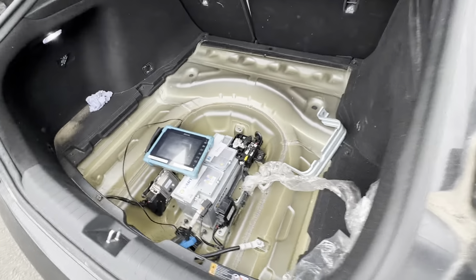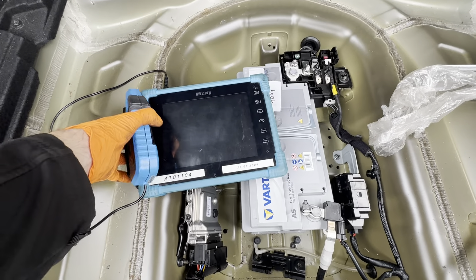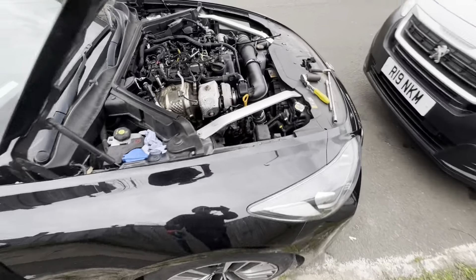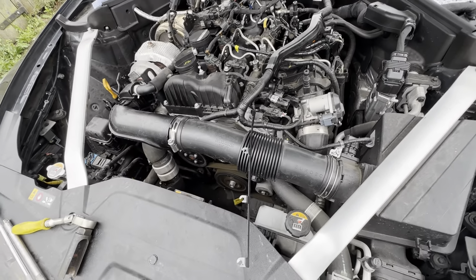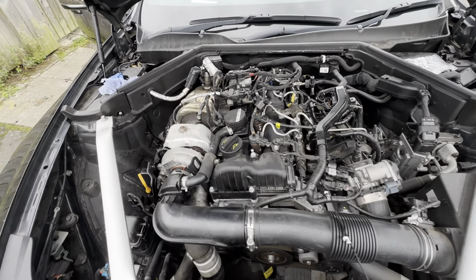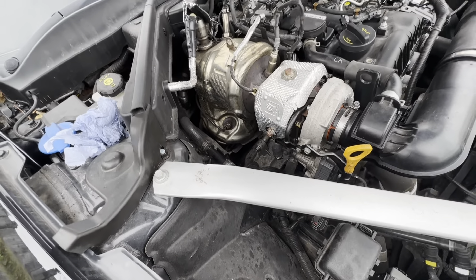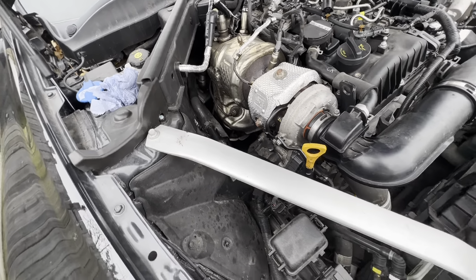Do we stick some DPF cleaner through it and it comes back with engine damage on cylinder four because of that glow plug tip coming off? Or have the garage that took the glow plugs out originally - have they snapped it? So that's the body of the issue with this one. On this occasion I think I'll pass the information on to the customer, tell him it needs the DPF cleaned, and he needs to get that cylinder looked at, and find out if they took the glow plugs out and broke one of them. They'll obviously deny it, but you never know.